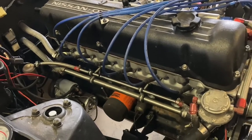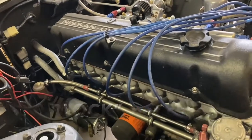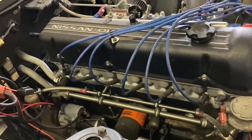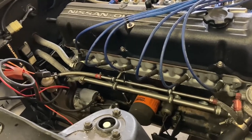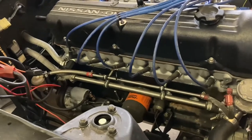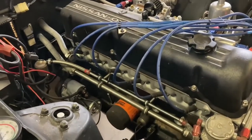We've got the E31 head on here - you can verify that there at E31. It is the P30 chassis, I think it's on the other side behind the headers. So we're gonna take out all the spark plugs and do some compression tests on this thing just to see what kind of compression it has, make sure the engine looks healthy before we go any further. Because if it's not, maybe it's engine swap time.